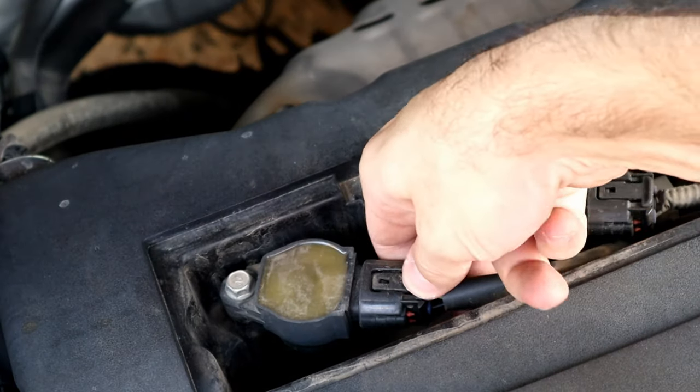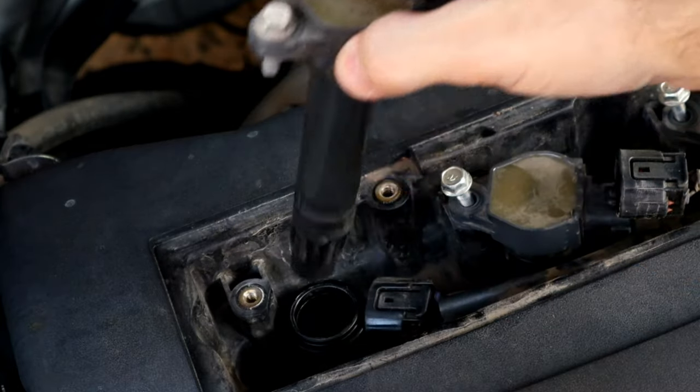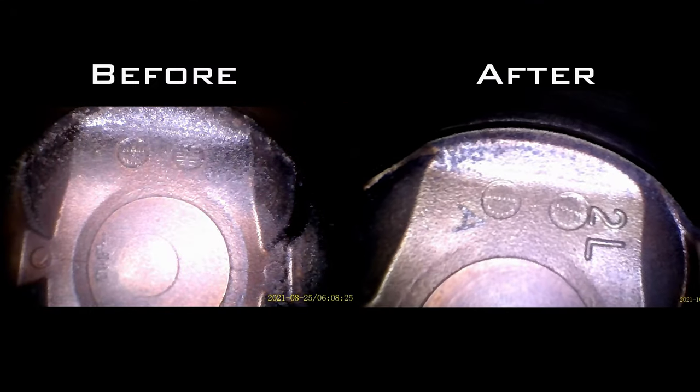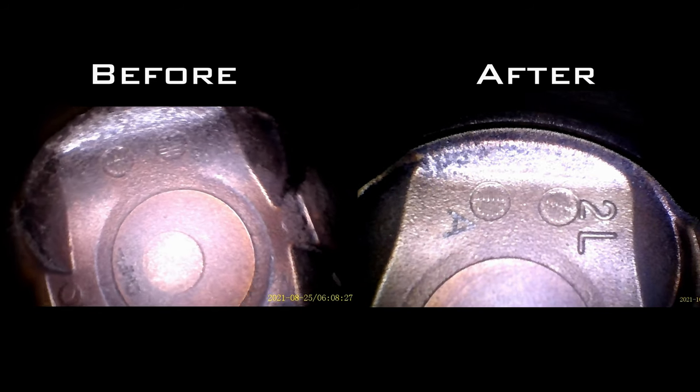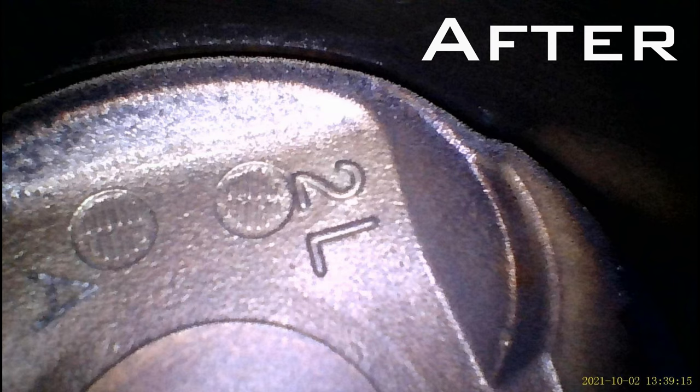We're back. I'm going to remove the ignition coil and the spark plug just to show you the cleaning result — I'll remind you again, you don't have to do that. The moment of truth: entering cylinder number one — looks like it removed a good amount of carbon, and that's only with half a can. You can also use a whole can for even better results. Here are the other pistons — the cleaning process works really well, just like the cleaning kit I used in my previous video.